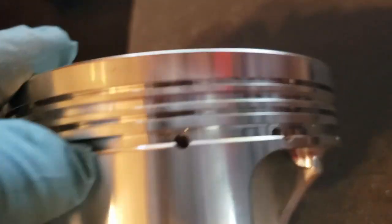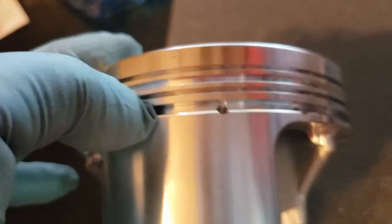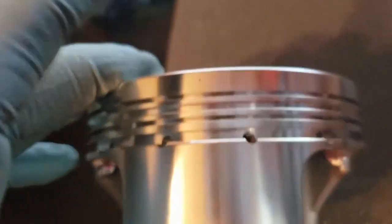We're going to get into installing the oil control ring. We'll start by putting in a support rail, then drop in the actual groovy control ring or expander, then drop in the top support rail. The oil control rings are the only ones you can spiral down onto the piston — go ahead and put one down there and spiral it down. For the top ring and mid ring, you can put them on by hand — they make a special plier for it but I don't have one. Just make sure you keep them even; you don't want to bend the ring.